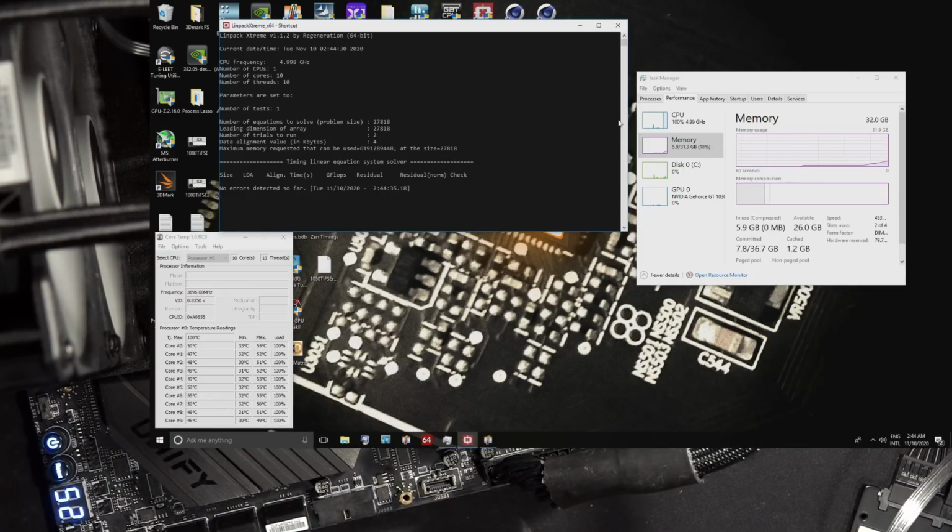The main point here is, maybe I should have run it at 4400, just to show that the two single rank setups, regardless of actual memory capacity, perform the same. Right? Well, let's hope this time it doesn't crash. I don't really have any other 16 gigabyte single rank DIMMs, so I needed to use these for this.